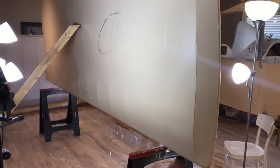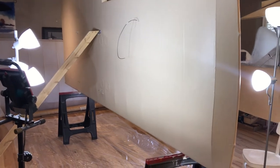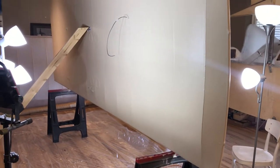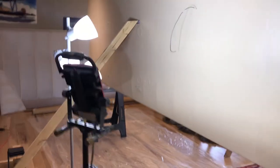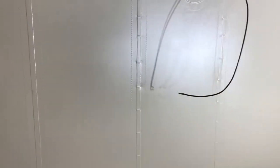The alternative is to make a big paint booth, get your spray equipment, spray it, and put the wings on a rotisserie so you can rotate them around. Which is possible and doable for those who want. But for me, this is the third set of wings I've done like this and the finish — I mean, you have a little bit of texture, but for the cost and the convenience, it doesn't smell, you can do it in your house. You trade time for money. If you want to spend $300 a gallon on the aviation stuff and spray it, go for it. But I am happy with this.